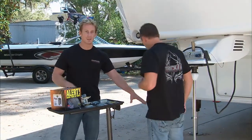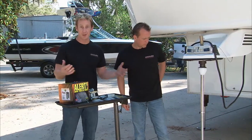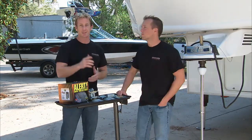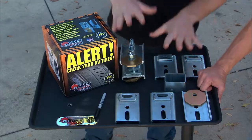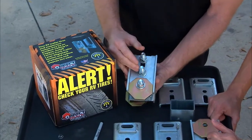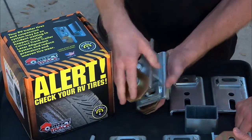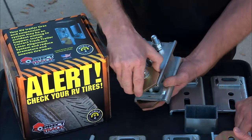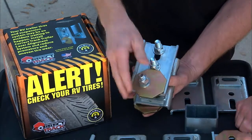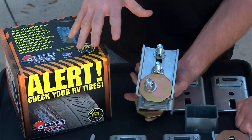We had a very cool tool to determine those distances, but at home don't be frightened — it's something you can do with just a plumb bob and a string or a tape measure to get the same measurements. Make sure you've got it all weighted down, make sure you're nice and flat, and take time with your measurements. When it comes to using the system, this is how you make up for the misalignments. This right here is the mount — it's going to relocate the mount for your spring. Traditionally it would be mounted right here, but we're moving it down to this hole. You can see there's a slot inside — that allows you to adjust it a quarter inch per click, two clicks puts you at a half inch, and allows you to move that spring and axle forward or back to correct the misalignment issues with your rig.